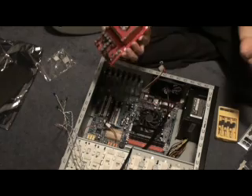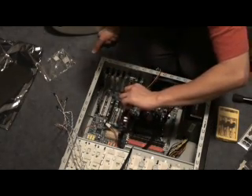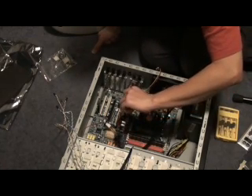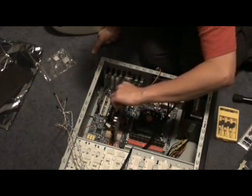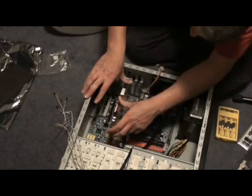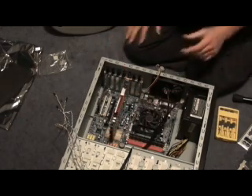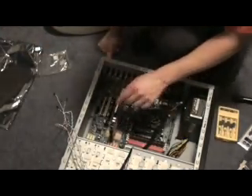There's nothing different about installing the graphics card. So we put our graphics card very carefully into the light blue slot of the PCI-E port. Gently push it — maybe push the back in first and then let the front slide in. Then clip the plastic thing over, and it's done.